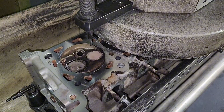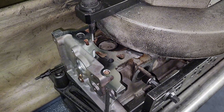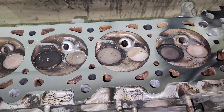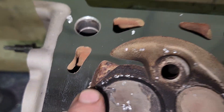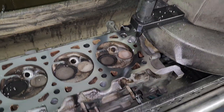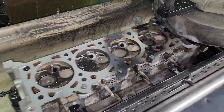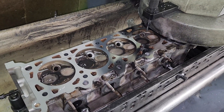I had to throw a little slow motion in there. Just got back to the other side — it still didn't clean right here, and almost cleaned right there. So I cranked it down another thou and a half. We're at four thousandths total once we're at this end, and then I'm going to do a half a thou on the way back and that should do it.